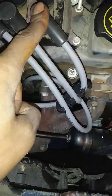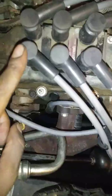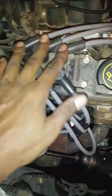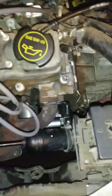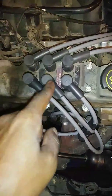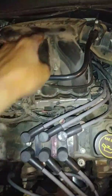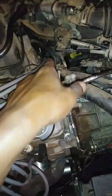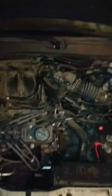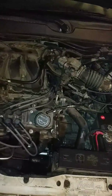Center is the shortest one. Second shortest is on the right. The longest one is on the left — because it's got to go all the way around the engine. Second longest goes right in the center. And the last one goes right off to the side down there. Follow the same path you used. May the creator bless you with your journey — keep rolling, peace.